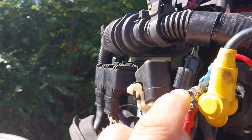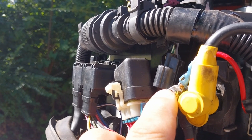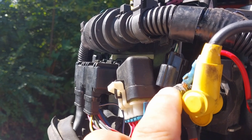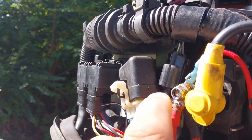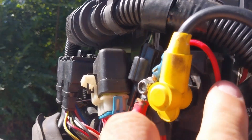Around here in the front is where the battery wire comes in for the main starting cable. I undid it and put my positive wire for the relay underneath it, so this fuel pump is drawing directly from the battery power going through it and into the pump. So it doesn't matter how many amps this pump draws — it'll always be supplied through this relay.